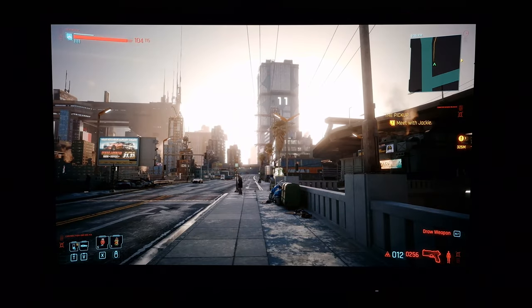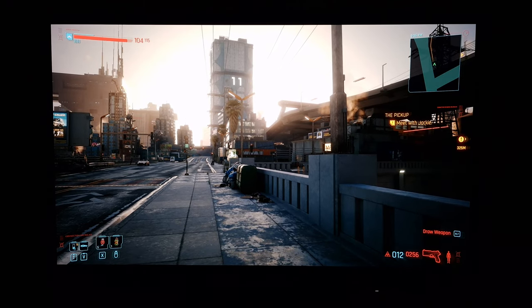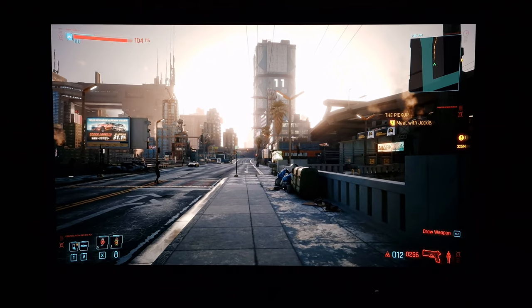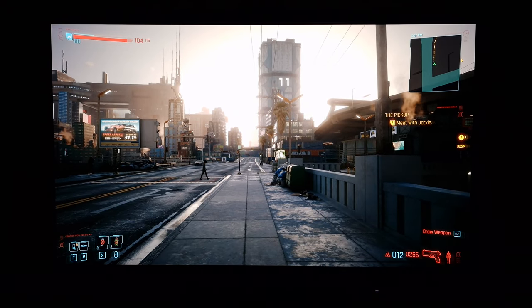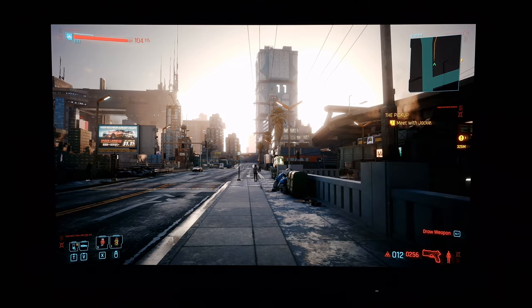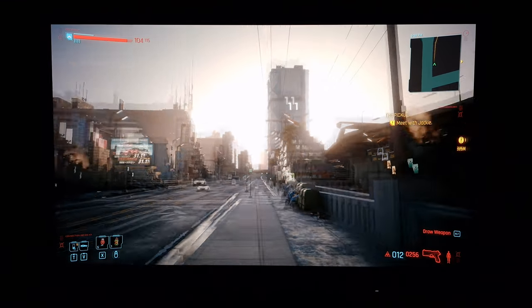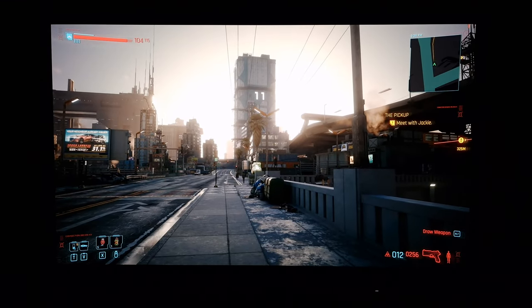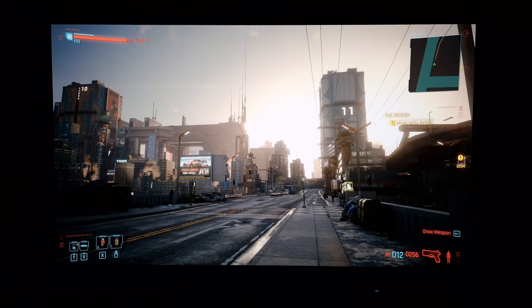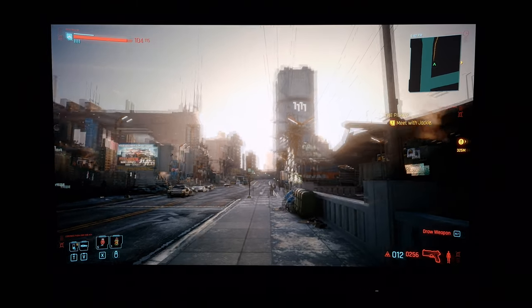And speaking of consistency, I didn't really mention this before, but yes, there's a 250 nits setting. You can calibrate it to various different brightness targets if you prefer with the hardware calibration. There's also a uniform brightness setting. If you enable that under HDR, it actually will keep it around 250 nits all the time, which is quite weird, because if you have the 250 nits setting active and you don't have uniform brightness on, then it will actually drop for a 100% window or for where there's a lot of very bright shades on the screen. Whereas if you've got uniform brightness on, it's going to be around 250 nits all the time, even for a 100% white window. So it's a little bit strange in that respect. Just thought I'd mention that.